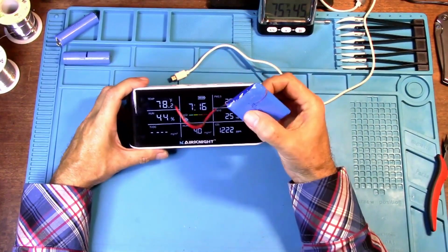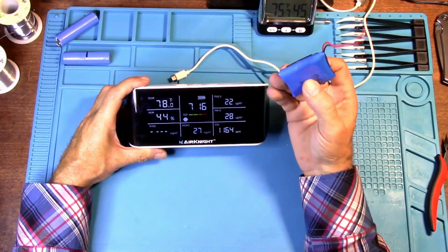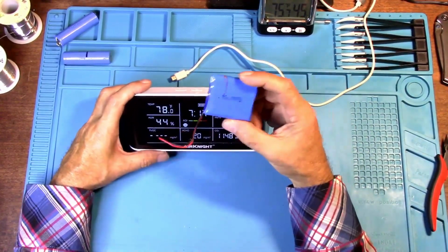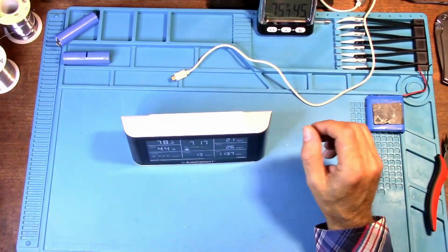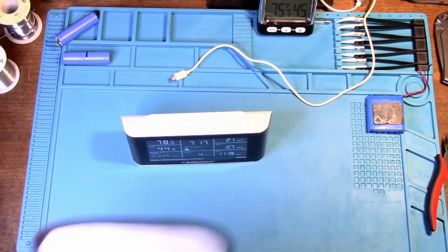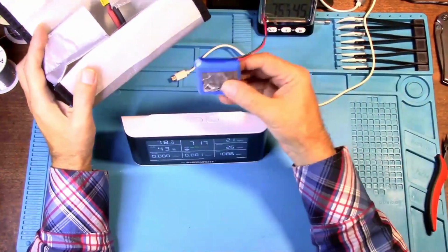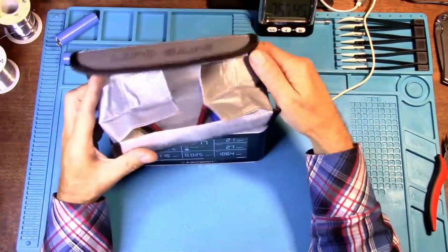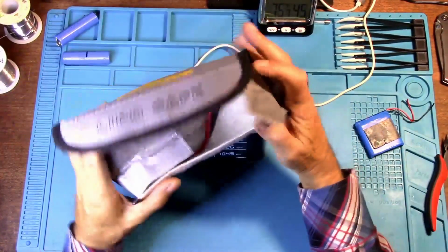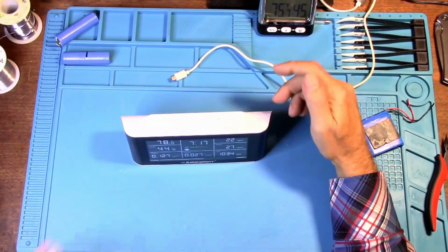Then your polymer battery, put it on a slow discharge and discharge it to a safe voltage. Take it down and properly dispose of it, and you'll be good to go. I just will feel a lot safer with this not in the house, for me anyway. And my other polymer batteries that I use for the spot welder, I have fireproof safes to keep those in. And that makes me feel a lot more comfortable having a fireproof safe to keep my batteries in. Now, if you want to keep this around for use for something else, you can always throw it in your safe as well in case it decided to go bad. I just don't like polymer batteries unless I absolutely have no choice. And with a cell phone, you have no choice. And with quadcopters or drones.